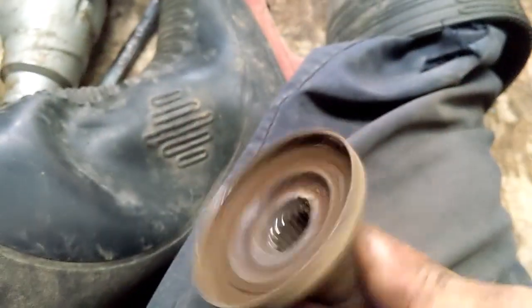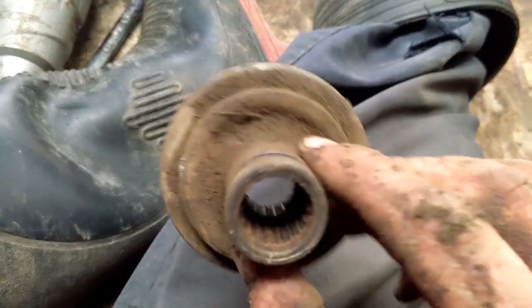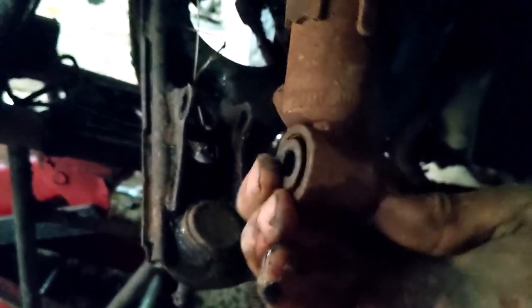These are actually reasonably dear, but I should have no worries finding one. So yeah, I'll need a new coupling, two new shafts, a new hub, and a new wheel bearing. I did also notice that the bushing on this shock is in poor condition. Come on, that kind of is rough. So that will be replaced at the same time.